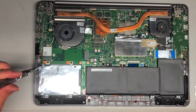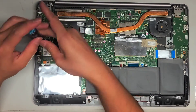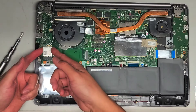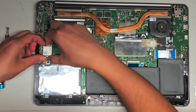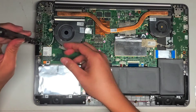You've got the hard drive here. Take that screw out, and then you can see you can lift this up. Once you lift it up, you can wiggle it and pull it back just like that. I'm going to put this back now and put the screw back in.